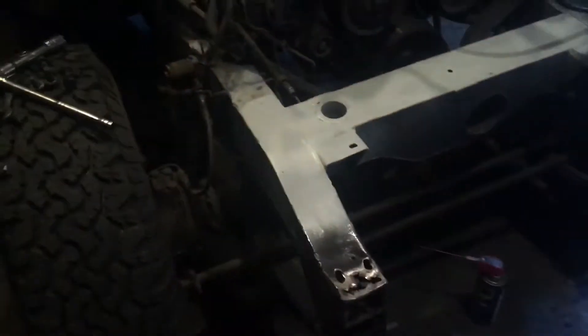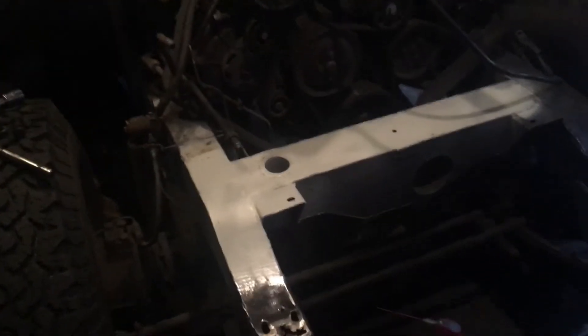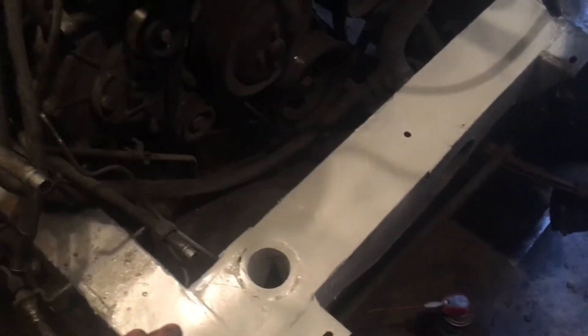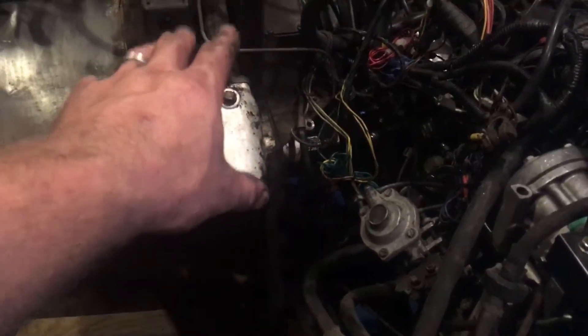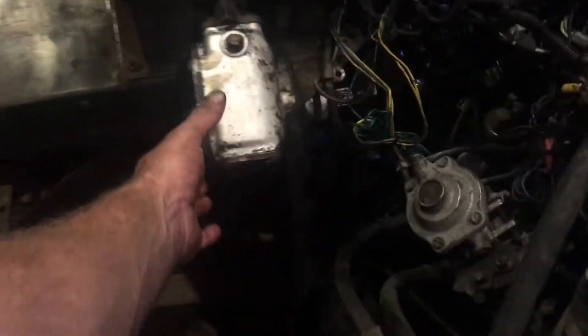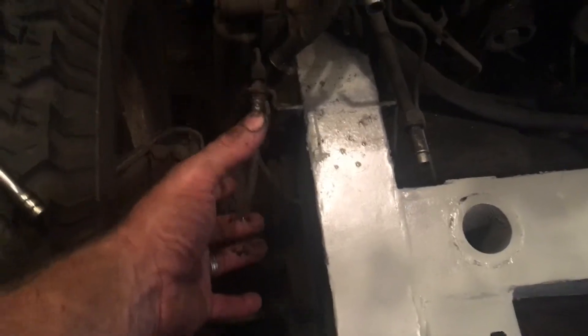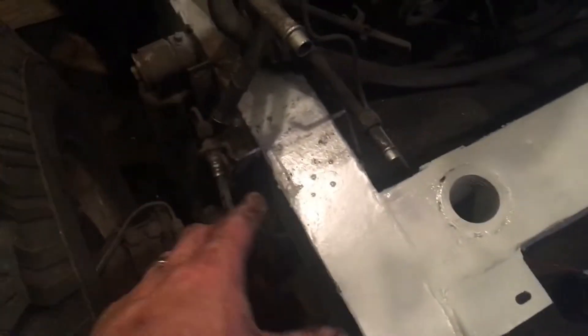In our case, we're going to leave it that way for now. We've primed around it and I'm on a timeline — I have to get this truck able to be dressed and put back in a driveway and look normal from the outside so I can get it back in the shop in about a week. We're very pleased with the layout and placement of the engine, and where we're going to put the radiator and intercooler is right on top of the bulkhead crossmember. For the power steering, we'll be putting a plate — roughly a six-inch by six-inch plate — that gives us enough room to drill the four holes needed for the power steering box, then buttress that so it's nice and strong.